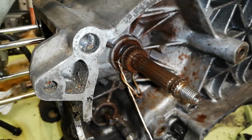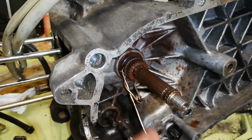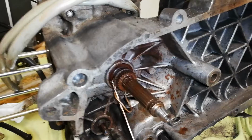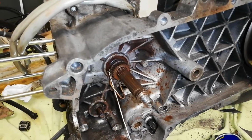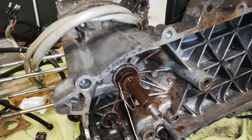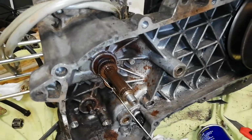And with that, it's destroyed. Because now this disc has absolutely nothing to grip on anymore and just slides around by itself and not with the crankshaft anymore. All this just because someone didn't bother to check, maybe there is something I should look out for. Yep. But now there's another issue. Now I have to replace this entire crankshaft. There's nothing you can do about this other than replacing it.